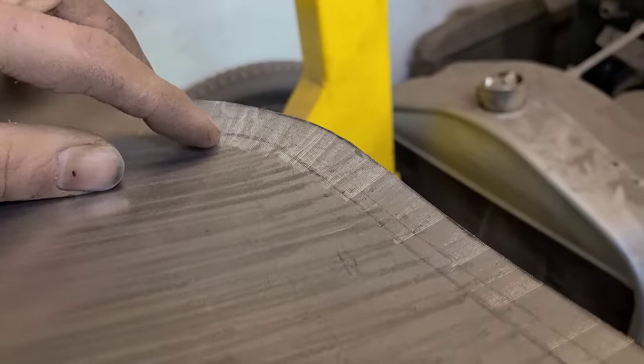On the other side, I took this angle and I basically shrunk and stretched it all to fit inside to this contour here. And then I spliced it in to this piece, and I just cut a piece like this. And then if this thing would ever focus, that would be really nice. Will you please focus? Yes? Okay. And then I just put in a flat piece here and then spliced it into the angle section on the bottom. Well, that ended up being a lot of cruel and unnecessary work.